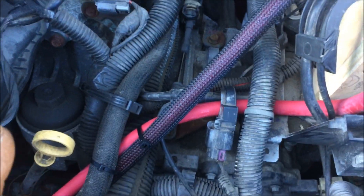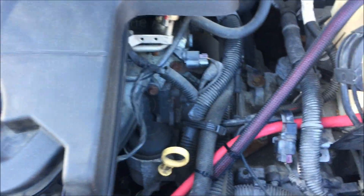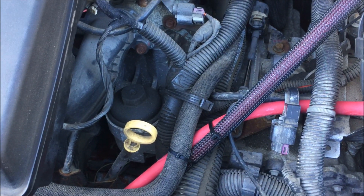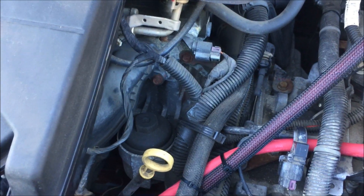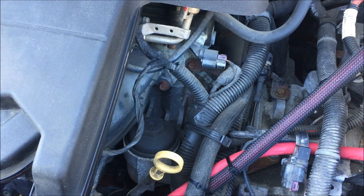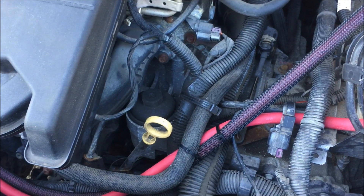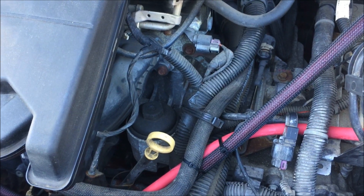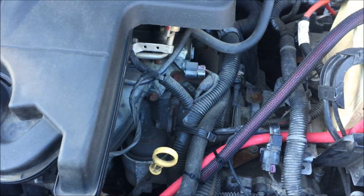I saw a huge difference in my voltage. The offset actually works a lot differently now — I can actually feel it kick in when I pull a heavy load off my electrical. My voltage used to drop down to full tilt after maybe two or three songs; I was seeing 13.4, maybe 13.3. Now at full tilt, the lowest I've seen is maybe 13.8, and it usually stays around 14. It's definitely a big difference in charging — my voltage isn't all over the place fluctuating anymore.